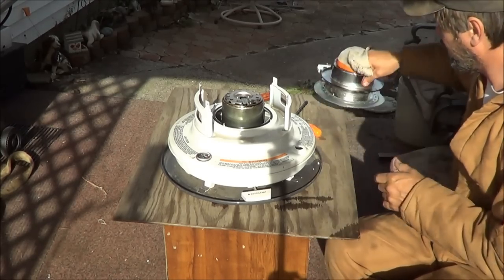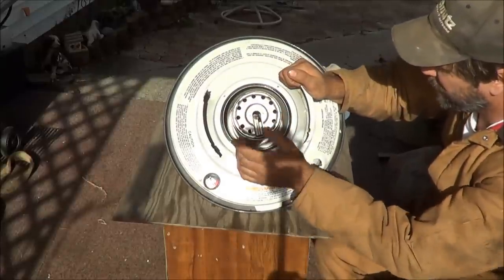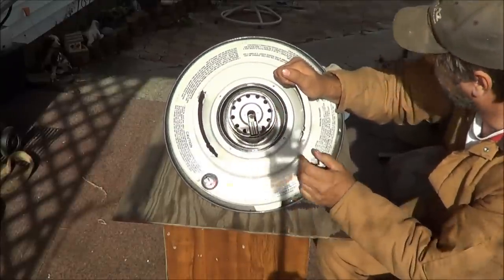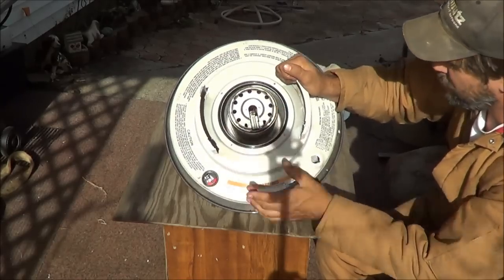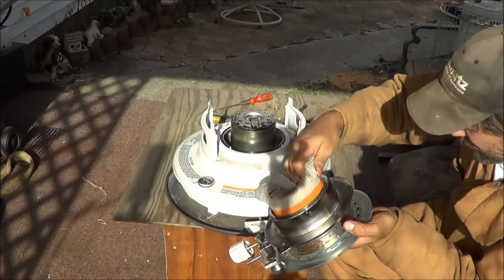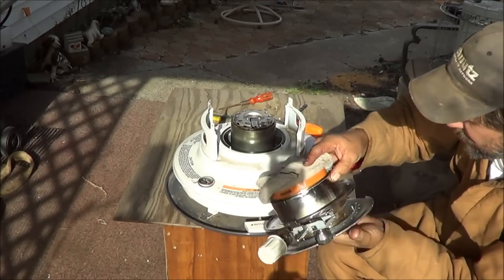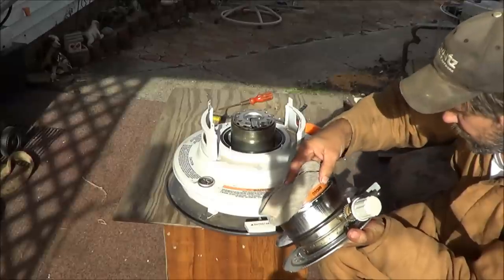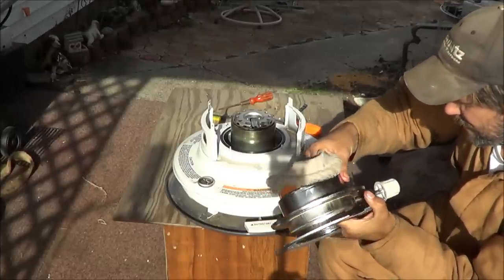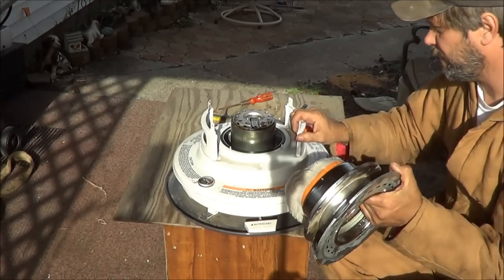Okay. Now what you've got in here is just this neck that comes up, and that wick goes over top of this neck and right down. As it goes, it gets sandwiched between this and your holder with the lugs in it. So you just want to make sure — the most important part is getting the wick in there straight and making sure there are no wrinkles in it. You want to make sure it fits tight against that back casing that's got the little pricklies in it. Some of them will have pins in them, so they'll be a little different.